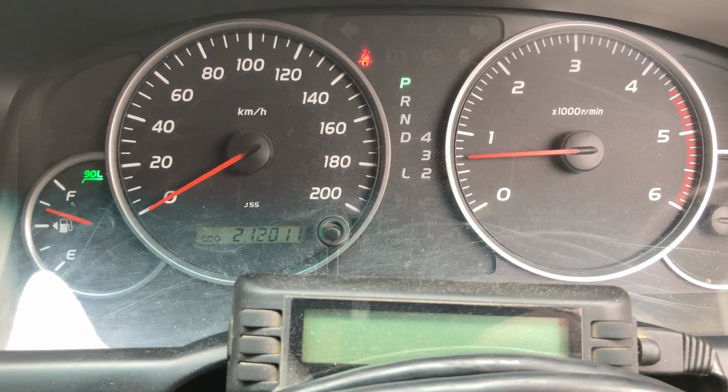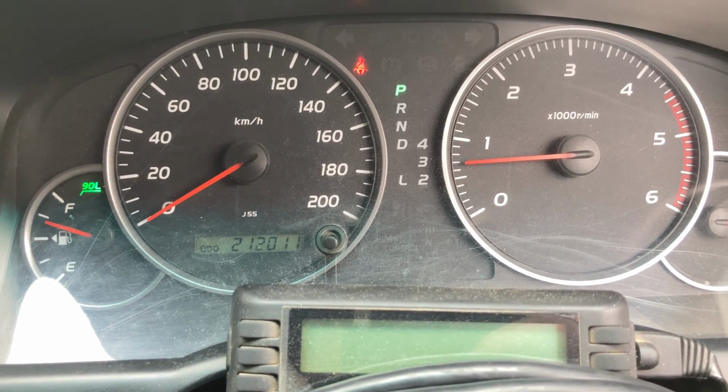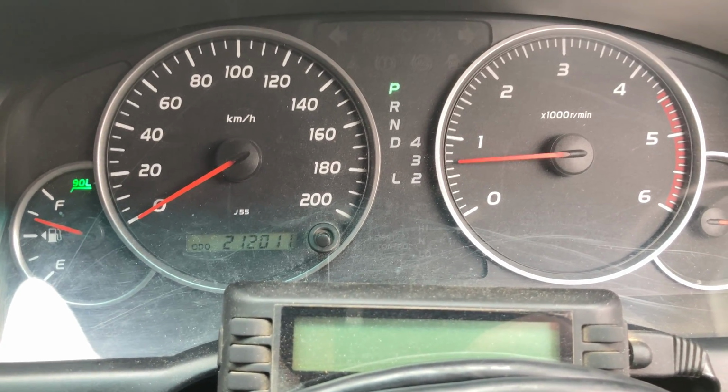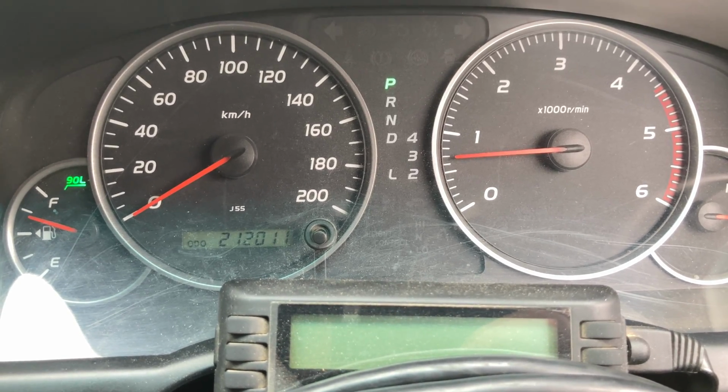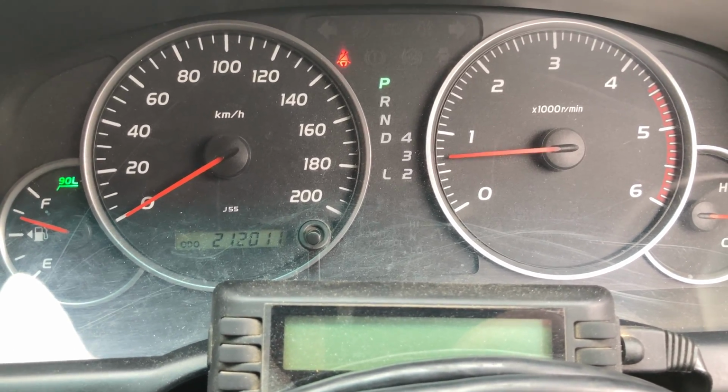Anyway, the fuel hose, of course, the fuel hoses go hard. This one won't have been changed in 14 years, so I'd be recommending a fuel hose without even looking at it. So an exhaust gasket, a fuel hose. I'd be recommending front wheel bearings either way, but we're about to have a look at the tyres in a minute.